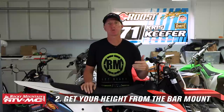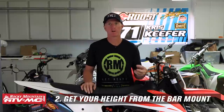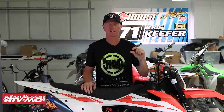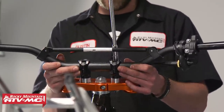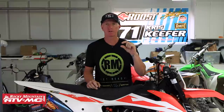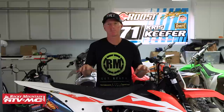You can either A, purchase a set of taller bar mounts, or if you guys are on a budget like me, you can get spacers from any handlebar manufacturer. They sell spacers for their mounts. Put a spacer in between your bar mount and your triple clamp, and that'll get you the height that you want. And try to go with a flatter, more lower profile bar.